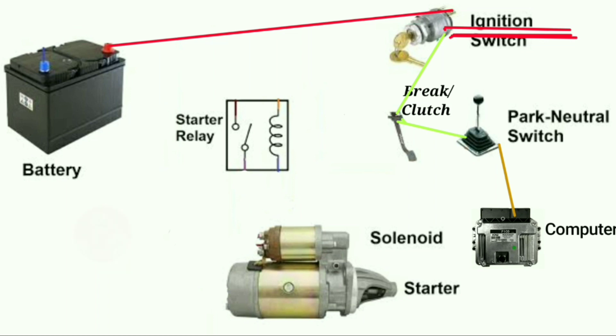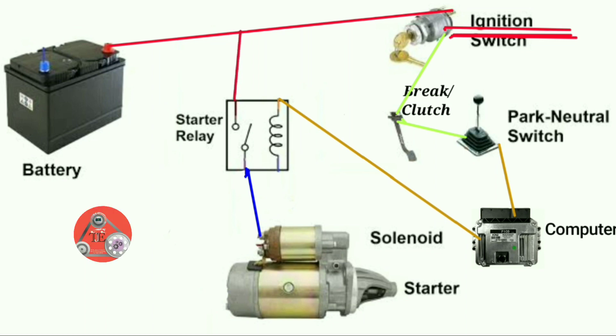From the computer to the starter relay, and then from the starter relay we go direct to the starter motor solenoid, because this solenoid is our switch. We also have another wire which taps power from the load cable onto our relay switch, because this is a switch that opens and closes for a given time, tapping all the power coming in to start the motor.